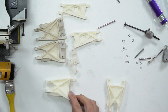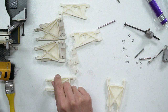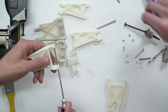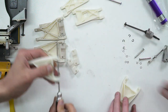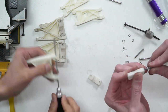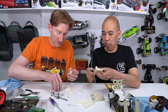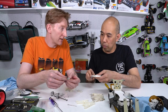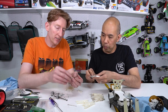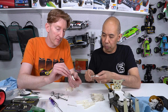So we're going to do all four arms - they're all drilled. Use the three mil on these ones. Checking this - it might need to be reamed out a fraction with the three mil. The mount and pin hole usually leave it a bit tight, and that can stay solid as the arm pivots. Otherwise you've got two points of slop. You need the arm hole to be just enough to press the pin in and out, so you minimise the slop.